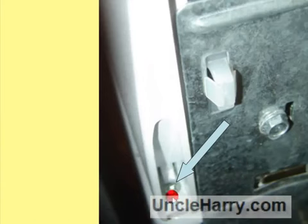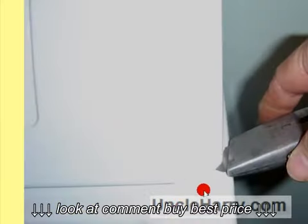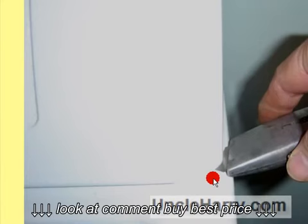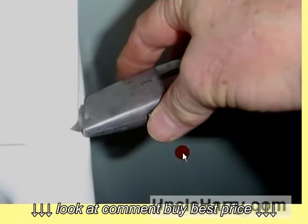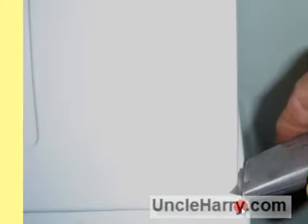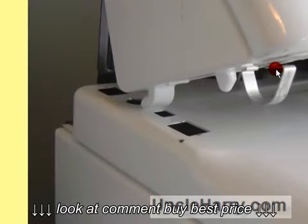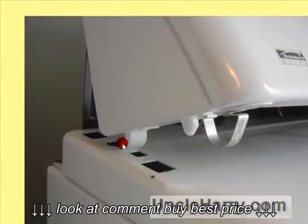In recent years, the screw has been moved from the front to the back, as seen here. And on the newest, the screws are invisible. In fact, well, they're not invisible, they're gone. Using a thin-bladed screwdriver or a razor blade, like I did here, if you push back in just this exact spot, you will depress this spring and be able to lift the console up and disconnect it from the hooks.